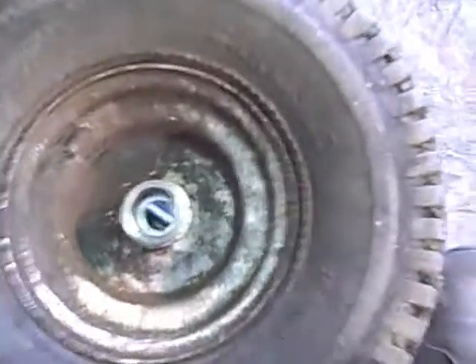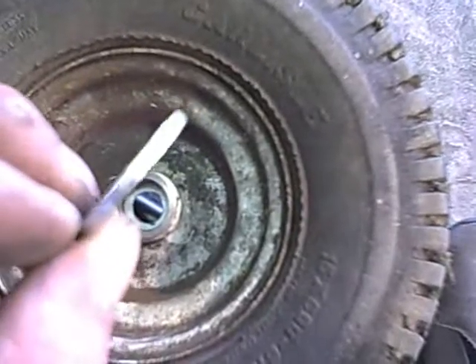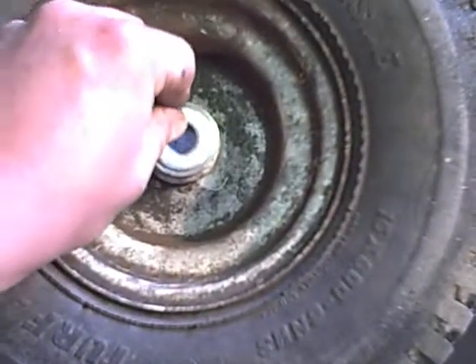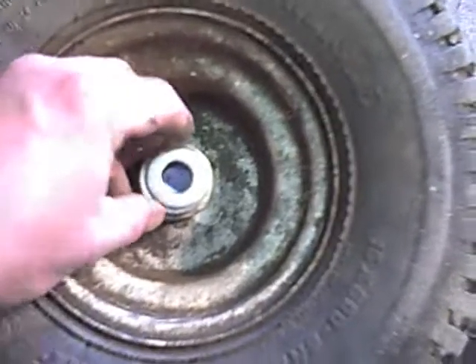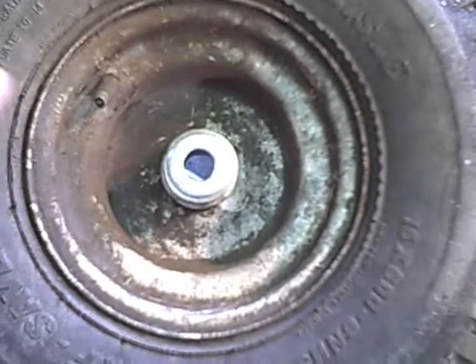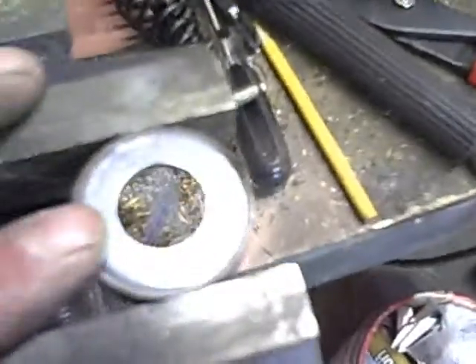On the other side where he has this torn off, I need to get another oversized washer — look how thick that is. I just found these laying around, I think it's from when I did a hitch kit on a neighbor's truck. If I drill out the middle with my step drill, this will take a weld around it without burning the tire off, and I'll have my homemade spindle.